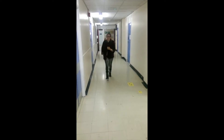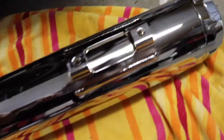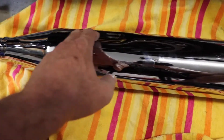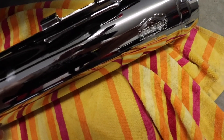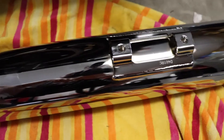One thing to note: there is a right and a left muffler. You can tell by the serial number written right here — the instructions will tell you which one's the right and which one's the left. The main thing to remember is when you're putting it on, this dent in the pipe should fit right up under your shock, and you should be able to read Vance and Hines on the side when it's installed — that way you know you've got it the right way. Be sure to clean the pipes real good before you crank it so you won't burn your fingerprints into the chrome.